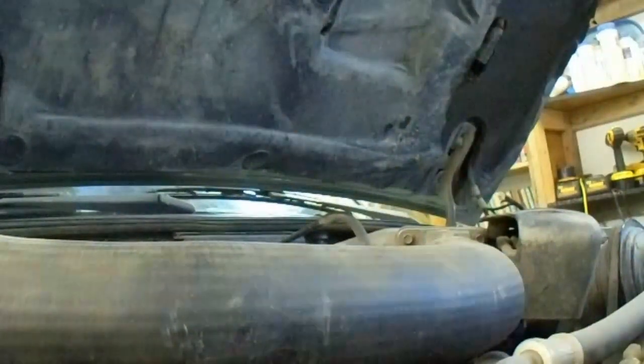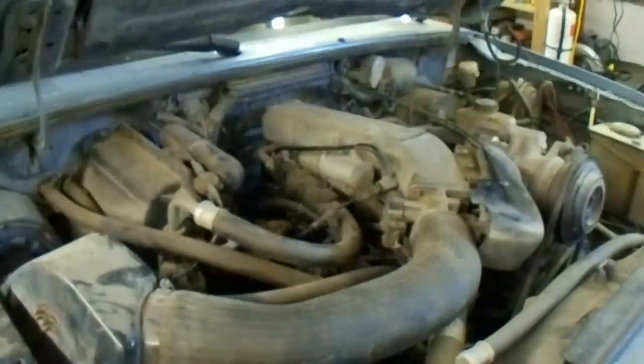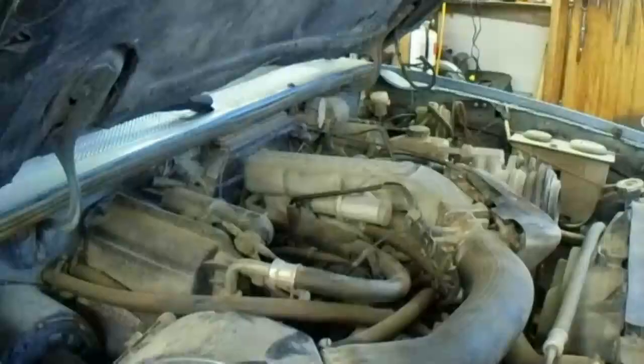We built a little pressure and the motor actually sounded pretty reasonable for a 2.9 — these are known for being a little clattery and making some noise, but this one sounded pretty decent. So we can safely assume this motor is worth saving. I've already prepped for it, and what I have is a new fuel pump ready to go in.